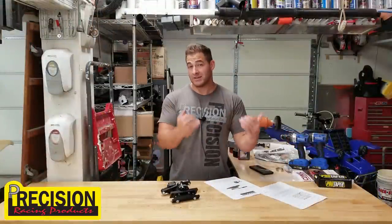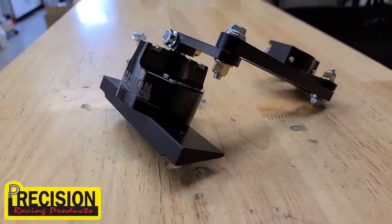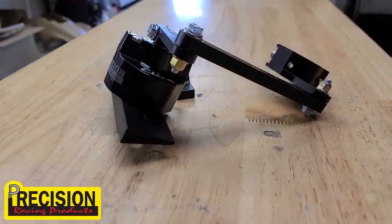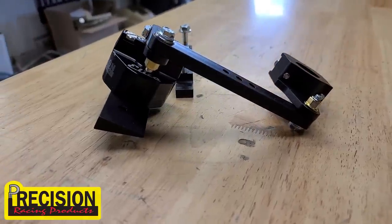And if you bump it up to the elite, like the model that I have, you're gonna get a couple more improvements. You're gonna have further adjustability for your steering and straight ahead damping. You're also gonna have larger wear surfaces, so this is gonna last a little bit longer than the other models. And it's supposed to have up to 65% better impact damping compared to previous models.